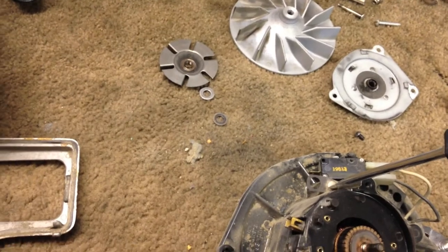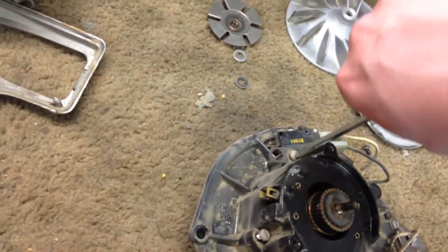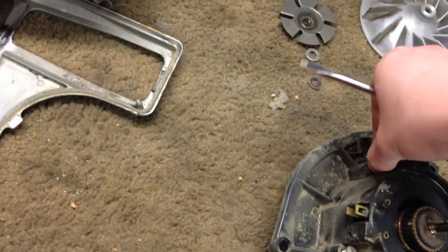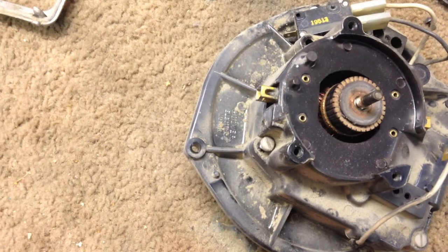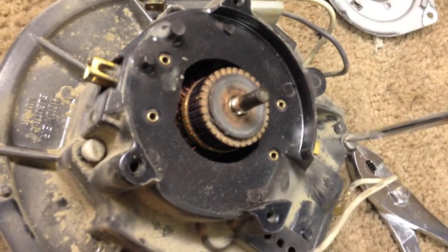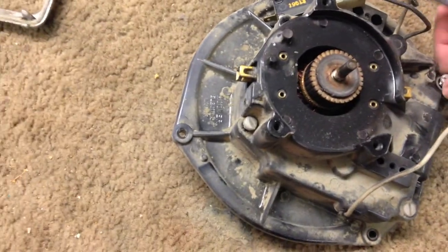So we're doing this in between other work, so this will be spread out throughout the day as I have a few free moments to work on this while parts dry. Mostly while parts dry, pick away at it. This is the longest one, dismantling it and washing it. And then this will dry. I wash everything, including the armature, field coil, the whole thing, to really give it a good cleaning, because I don't want dirt, I don't want the motor to smell like hot dust when you turn it on.